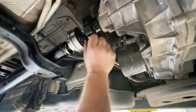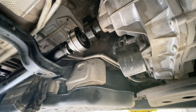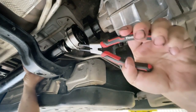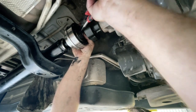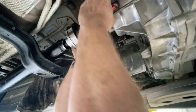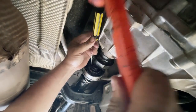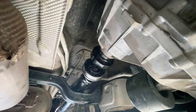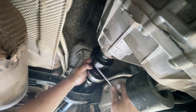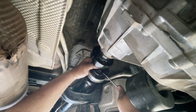And that's now on all the way. We can just feel that that groove is now there for our circlip. Now we can try and get this circlip in place. I just want to go around and make sure that that's fully in place. Even with a little bit of grease it's super hard to see, but spend a moment and make sure that circlip is fully in - we don't want that coming out.